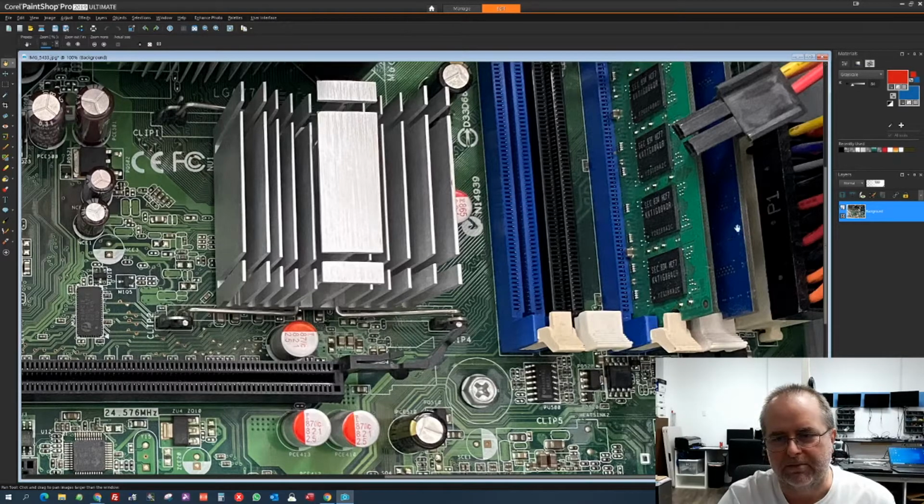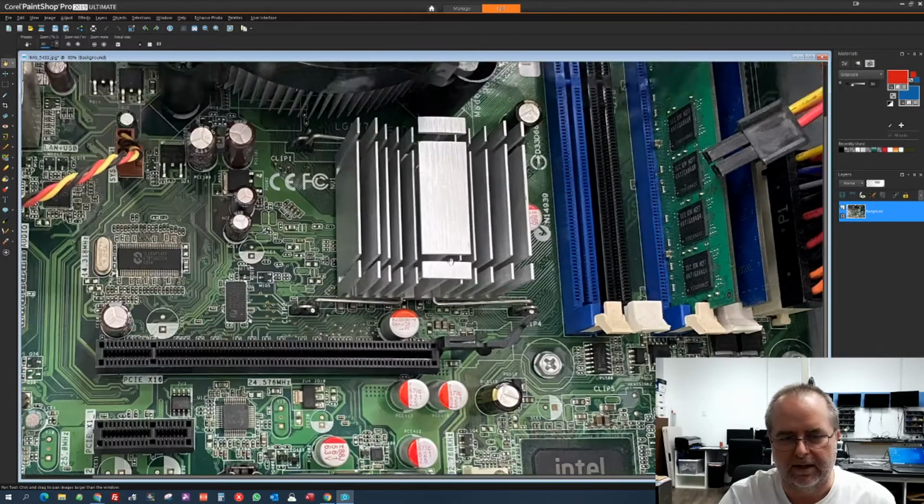But perhaps the more important aspect of this is that motherboards want you to plug the RAM in a very specific way. They will usually color code which two you plug in first and which two you plug in second. In this case, this motherboard color coded two of the slots in blue and two of them in black. So according to the motherboard documentation, which would have to be looked up, either both blue slots are supposed to be occupied, or both black slots, or all four of them would be fine too. So that's the second item of concern.